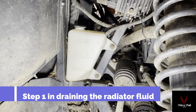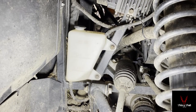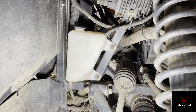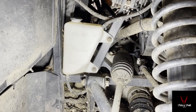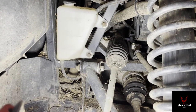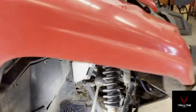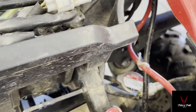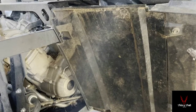Yamaha recommends step one is to drain the coolant overflow reservoir. Mine's already drained because it exploded all over the place when it overheated — slight silver lining. Normally you'd take this hose off, open the lid, and it drains on its own. You'll also want to remove the radiator cap so airflow can get from the top to the bottom, where the drain bolt is at the lowest point of the vehicle.